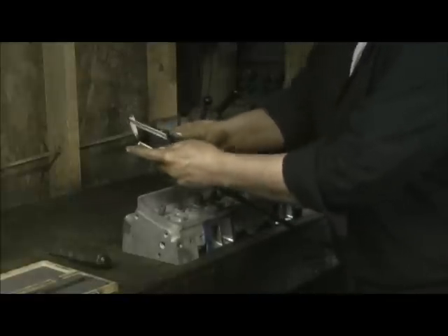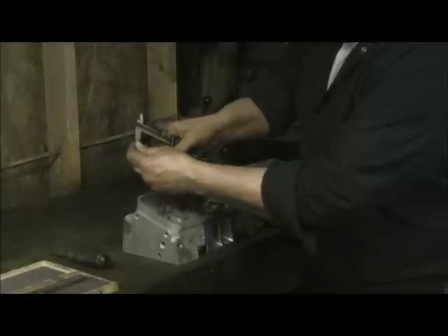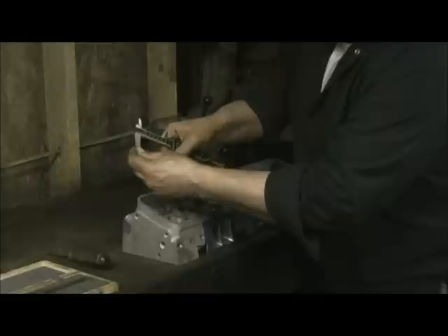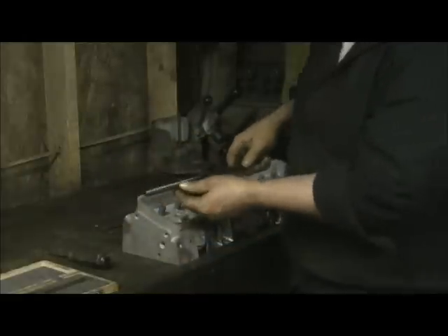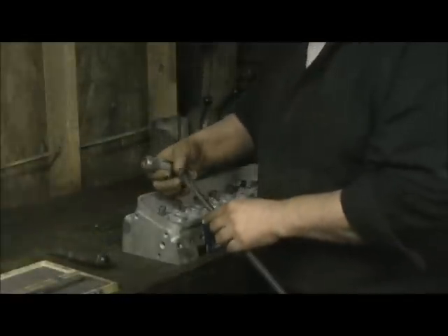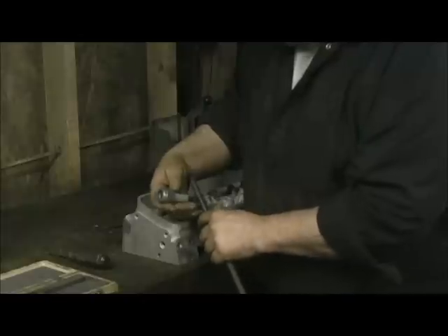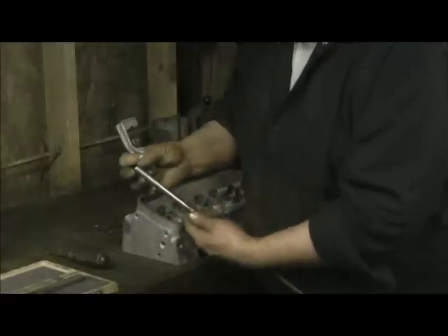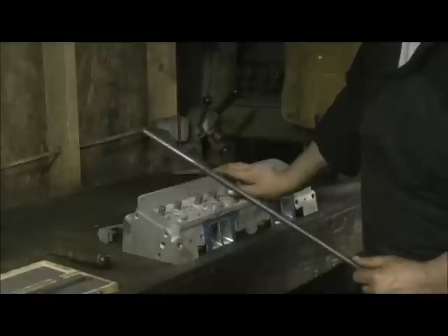Typically it's real simple — I take the tube, put it at the top, let the top of the caliper anchor off, and use the bottom as a point like a scribe to make my mark. You'll plainly be able to see it. Then I take a tubing cutter — this is one I got at Walmart for a few bucks — and I'll cut it, giving me a beveled edge. I've got to cut four of them.